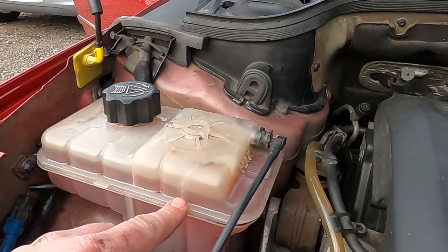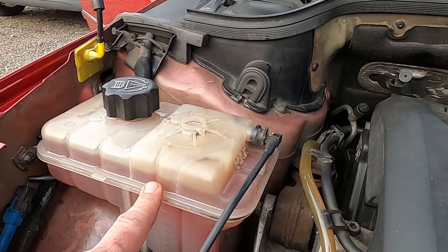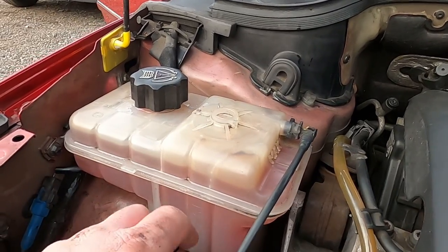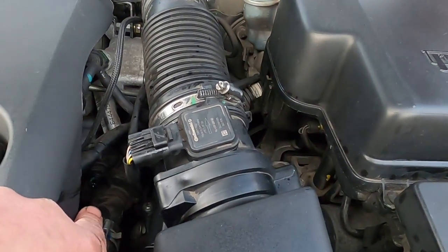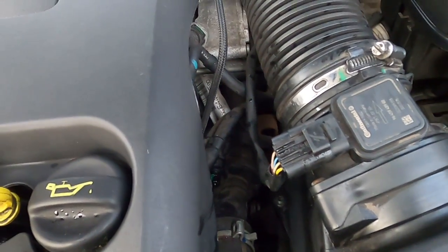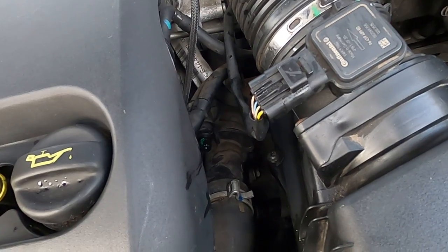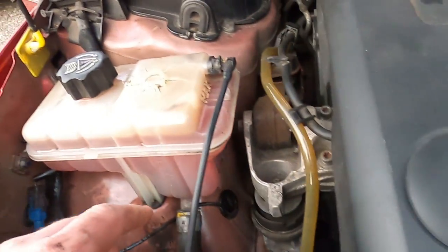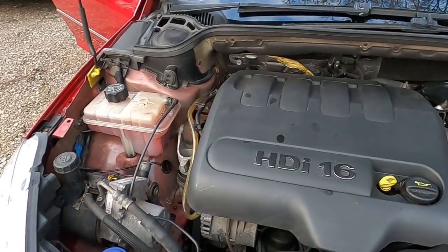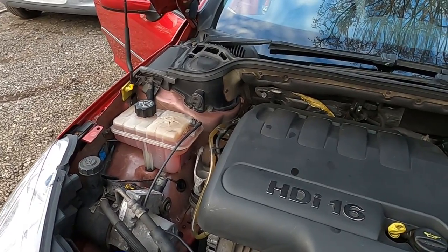As you can see, I left it a tiny bit over the maximum of the expansion tank, and that's because I believe there is still some air in the system. So I'm going to drive it for a couple of days. If the level doesn't go down to max, just a tiny bit, what I'm going to do, when the car is cold, is open up that little bleeder just a tiny bit. But be careful if you do as well, because if you lose that cap, then you're going to have to hold the thing with a finger until you find it, because it just has to be done back up. So I'm going to undo it a little bit, release a tiny bit of coolant in order to level it up to the max, and then do it up and leave it perfect. Because if it doesn't go down in a couple of days, I'll be confident that all the air is gone and the job is done and we don't need to think about it again.